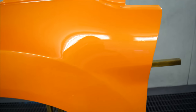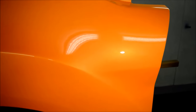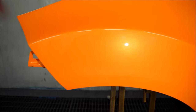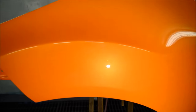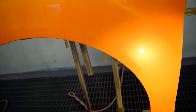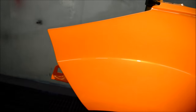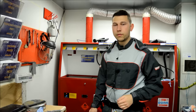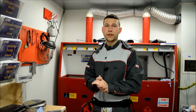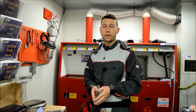This is the wing with the final finish. I used the SATA 4400 for both the base coat and the clear coat. I'm showing you the pearl under the Sun Match — it's not patchy at all, it's gone on really nicely. I'm quite happy with the 4400 — I really put it to the test with this colour. You might want a larger gun for a full side blend on a vehicle rather than a small test panel. Check out the next video for the clear coating process. Thanks for watching — don't forget to check out the YouTube channel, Facebook and Instagram!